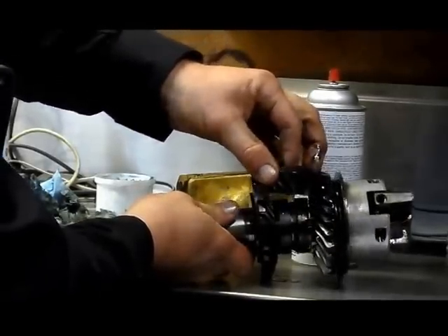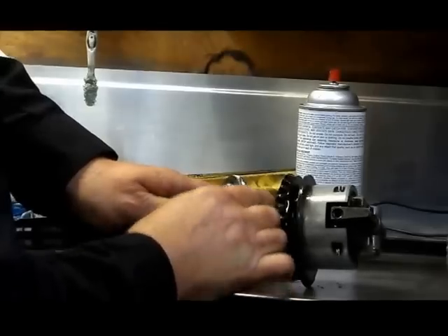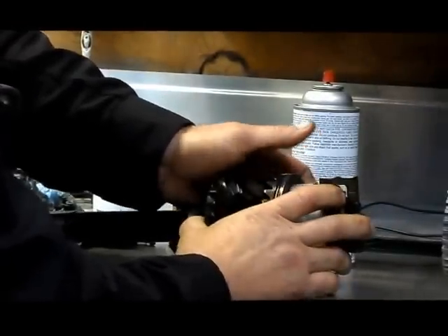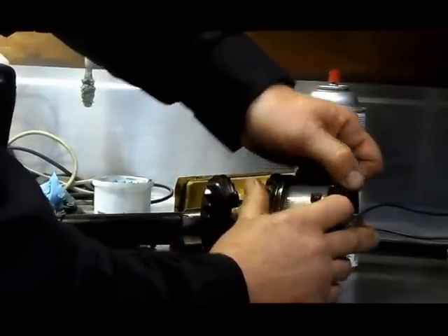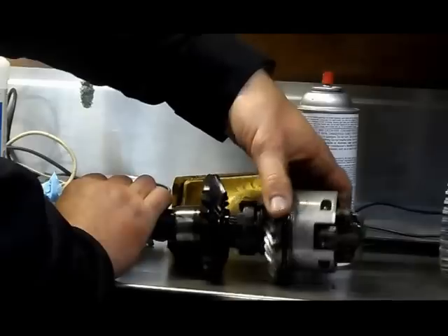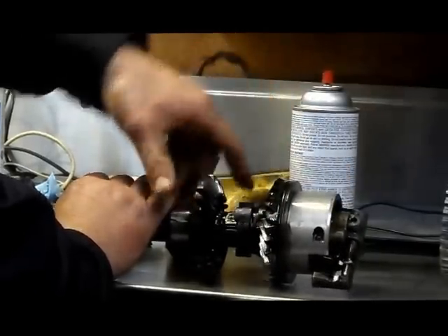This is still in here, but now because the clutch dog is engaged into this gear, it will turn the prop shaft. And it's just the opposite in forward — you pull up, the clutch dog goes into forward, and you can see it intersects with the forward gear, and now it is going to spin the prop shaft because the cogs have intersected with the forward gear.